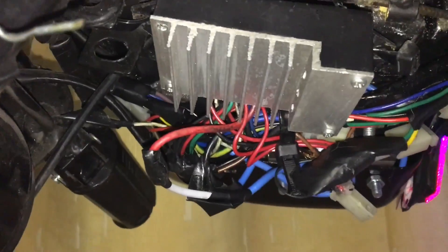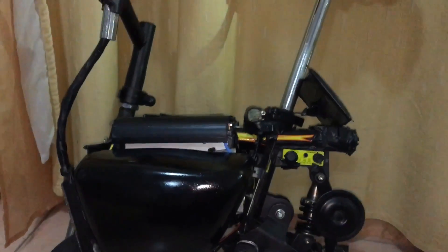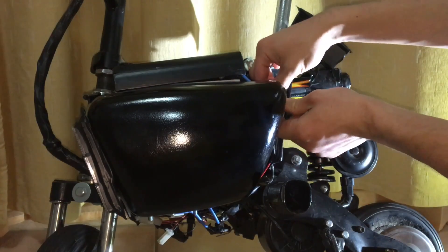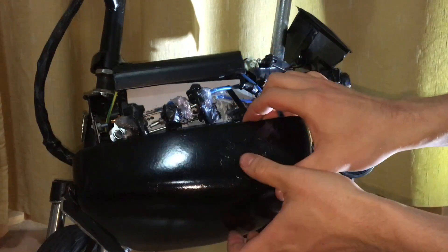You can see here mine in this case is underneath the scooter and in order to get to it, I'll need to open up the battery cover and pull one of the batteries out in order to get access to all the cables underneath. So I'll start by opening up and removing the battery cover, then the first thing you want to do is to disconnect the battery cables, and after that I'm going to go ahead and remove the two position switch.